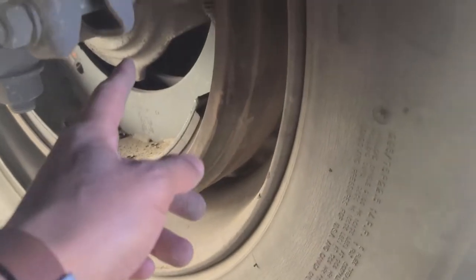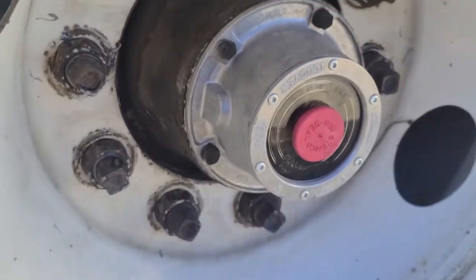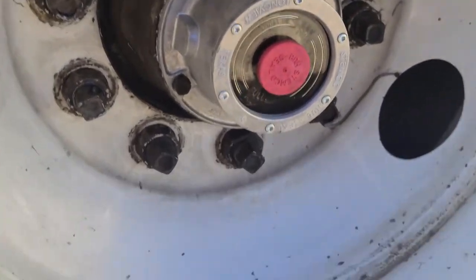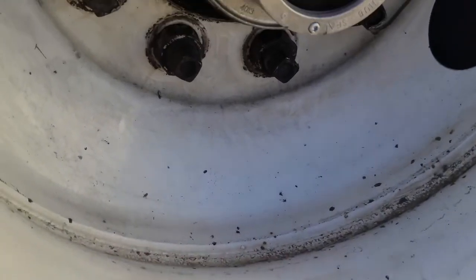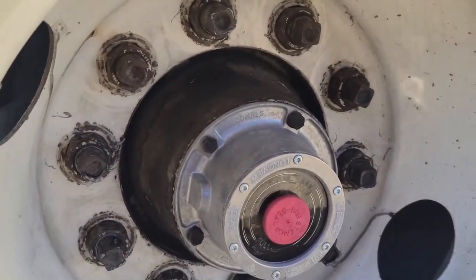My inner and outer hub seal — there are no abrasions, bulges, or any type of cuts. If there was a leak I would see a puddle down here. It's securely mounted and not missing any hardware.